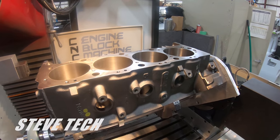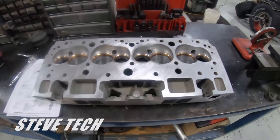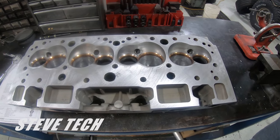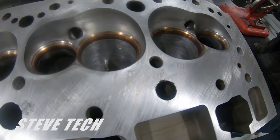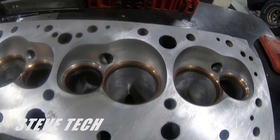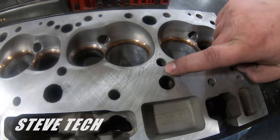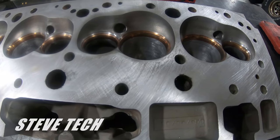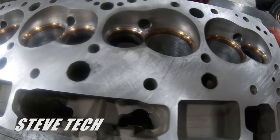Let's go over and look at the cylinder head and I'll show you the difference and why we resurface them. These are a set of cylinder heads a customer sent in with a complete engine. We took the heads off and noticed an atrociously bad surface finish. This is after we cleaned it up — not resurfaced, just cleaned. You can see where somebody cut and resurfaced it with either a dull tool or the wrong tool, and it tends to drag and cause a really poor surface — it's quite literally scratched up.